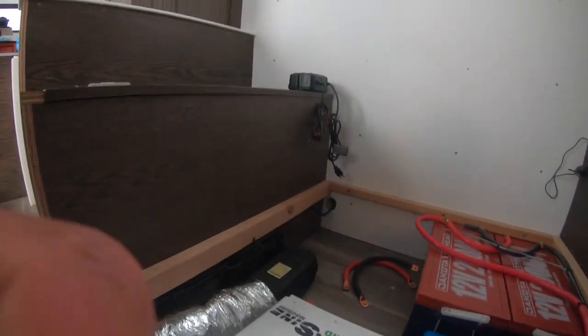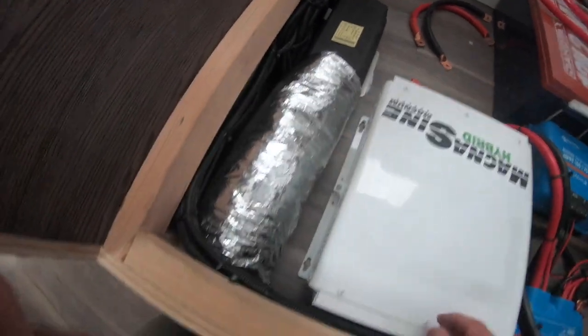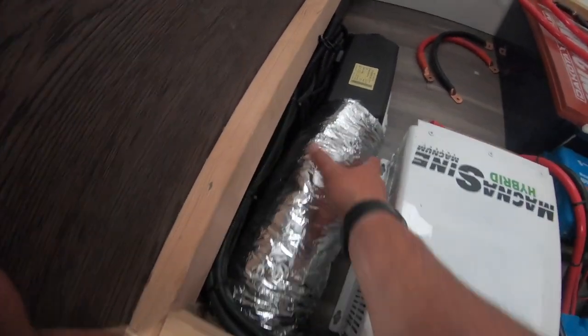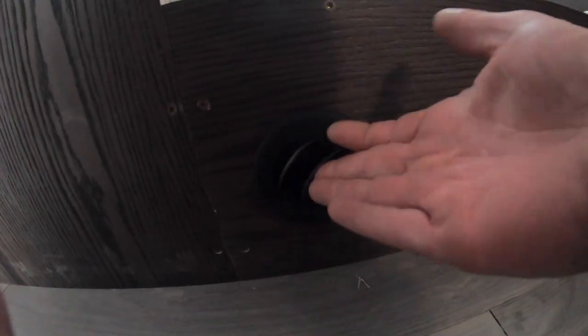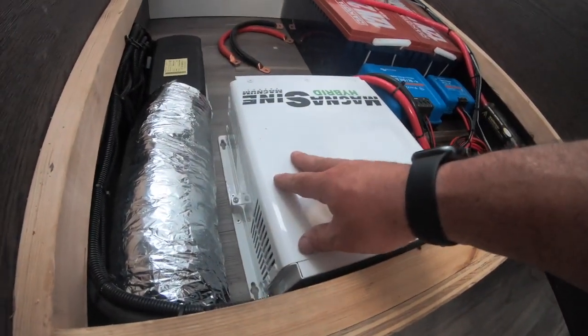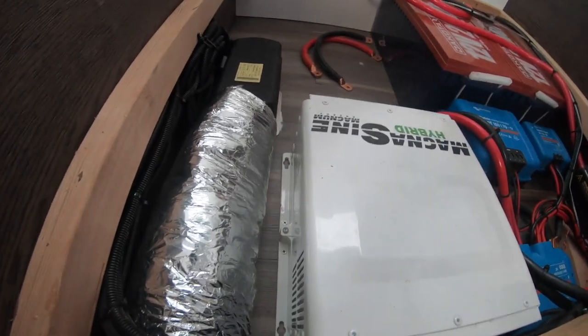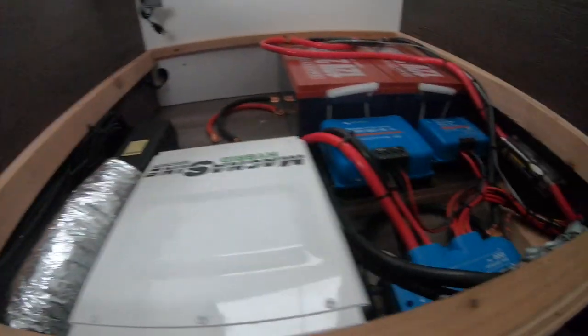That concludes the install of the planar air heater, and a couple of cool things we did to make it function a little bit better. I used some ducting that is a three-inch interior port dimension with fiberglass insulation and foil facing on it. That's going to cover all the way from our heater to our outlet port here. What that's going to do is try to keep that heat where it belongs and not let it come over to our inverter too much. Right now we've got about an inch and a half of clearance, which isn't a ton, but I think it's enough.